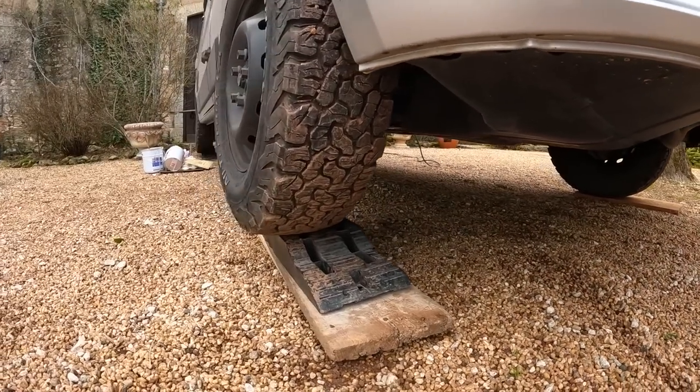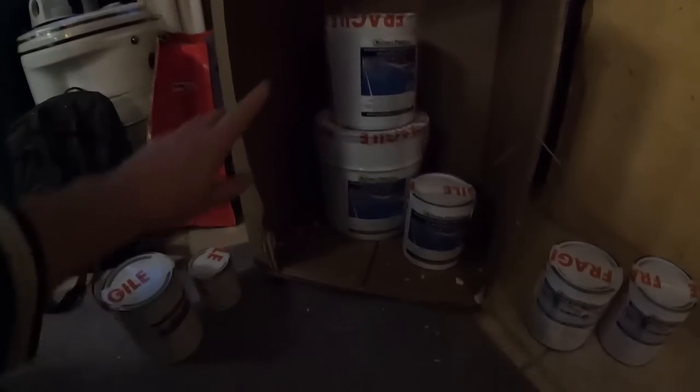The scariest part of the whole install will start now. We have been doing some preparations, so we are using self-leveling epoxy. So we need to actually level the van first. We are not just using one epoxy. When this is installed, it's three epoxies. First is the primer, what we are gonna do now. And after 6 hours, we're gonna put the epoxy mortar over there, and then wait for 3 days, and then we have the top coat on top of it. So 3 epoxy installs.